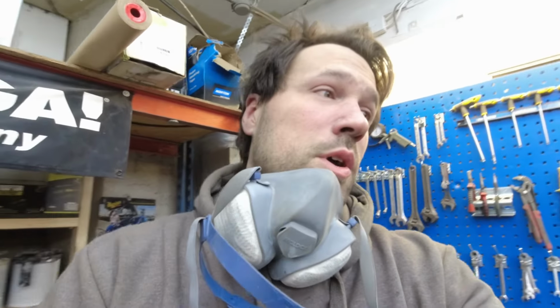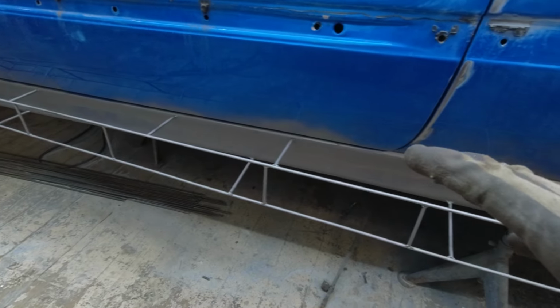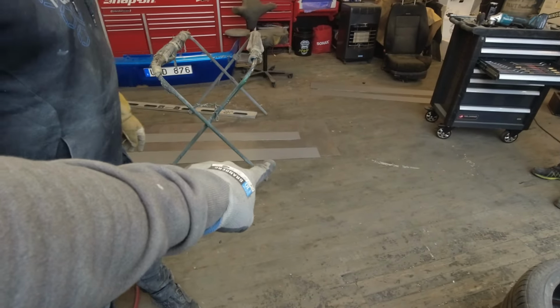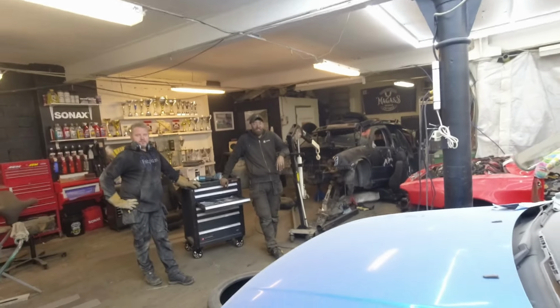Okay everyone, the skeleton is now primed with the zinc coating, so everything's zinc coated and we're not going to get any corrosion. And as you saw before in the video, I zinc coated the plates that we're now going to weld, and we're taking precautions, so all three of us are going to hold up the plates. The plates are on the ground there. We're going to place the first one underneath, hold it up, and then the excess material that sticks out, we're just going to cut off. And then yet again, zinc coat. You can never get too much zinc on there. You don't want it to rust. I can't preach it 100 times. So I'm going to put you on a time lapse because none of us are going to be able to film.